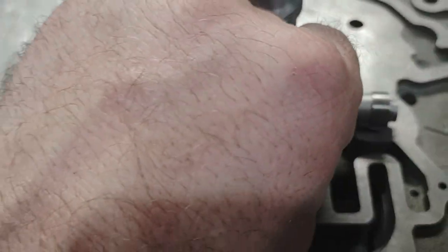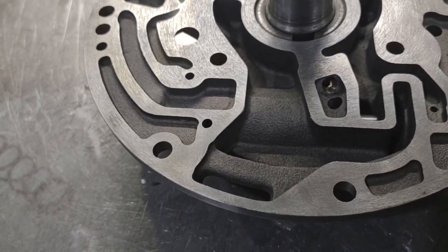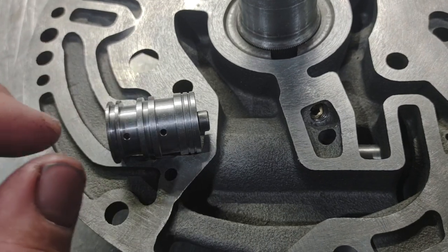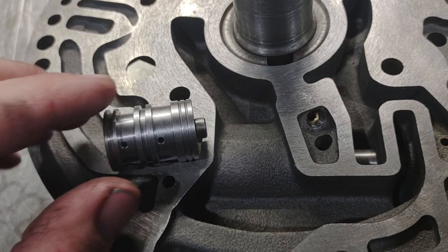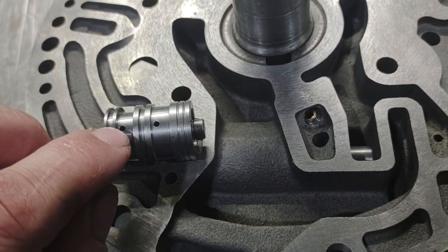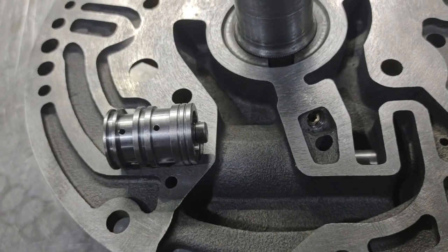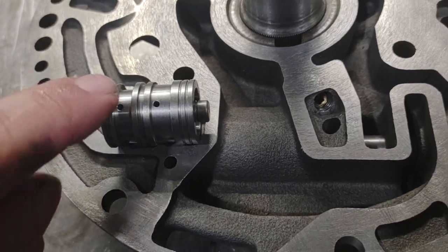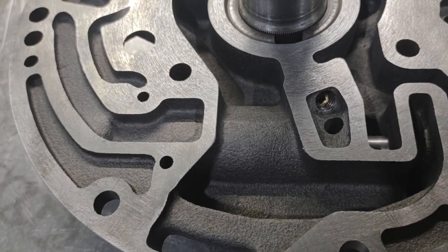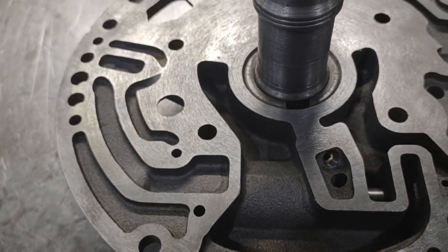The AFL circuit is important for that reason. In the case of most full manual valve bodies on a Turbo 400, they may not use the boost valve and may come with a really stiff spring, or they may still put oil to the primary booster but it's usually just straight line pressure — a circuit in the valve body that puts oil straight back to the boost valve to set a fixed line pressure. That works fine, though there's some room for error with leaks that can cause the line pressure to not be as anticipated.